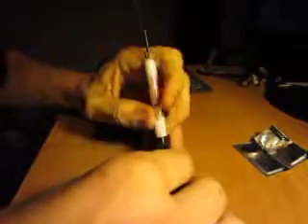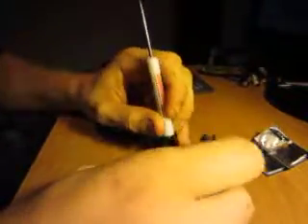First, you open up the key like so. What you need is a screwdriver — it's good to have a flathead and phillips. If you look inside here, there will be a little tab right in there. The phillips head is actually easier there. You push down on that little tab, and then you just slide that part of the key out.